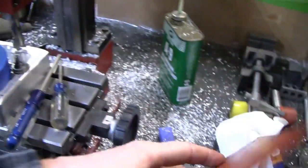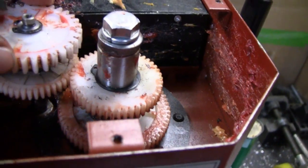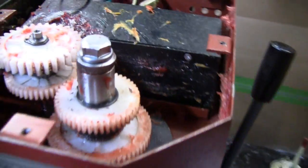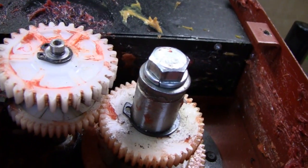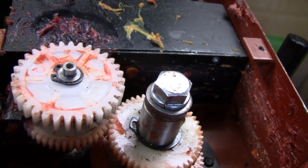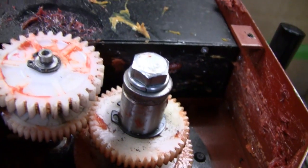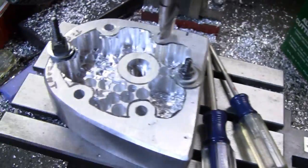We took the top off — only three or four screws. Everything actually looks pretty good in here. I don't know if you're supposed to lubricate these plastic gears because it seems like it just gets thrown along the sides. There's no remnants of a piece of key or anything like that, so I think that's what created the damage. I'm going to order a gear — I bet somebody makes metal gears for this thing, but I'm just going to replace it with the plastic one, put a new keyway in, and call it done. I might have to give Mike this thing and take it home, let him finish it up, or we'll just wait until we get the parts.